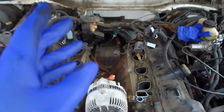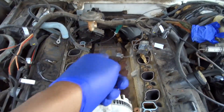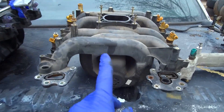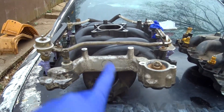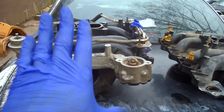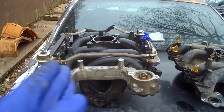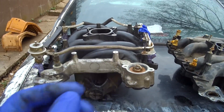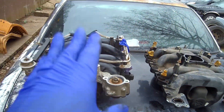This coolant tube that comes from the water pump all the way back to the heater core has to be changed due to the fact that the intakes are a lot different. This one is a little more lower and shallow on the bottom, and this one here, which is the PI one, has a lot more loop to it and is a lot more taller. So we're going to have to change that — get a hose or create something to make it work once we do the head swap.